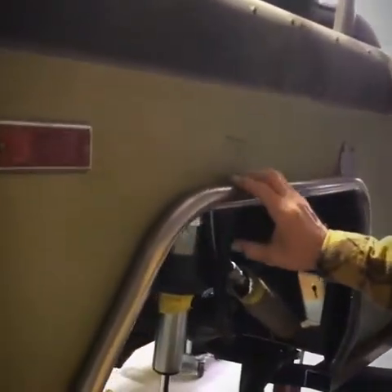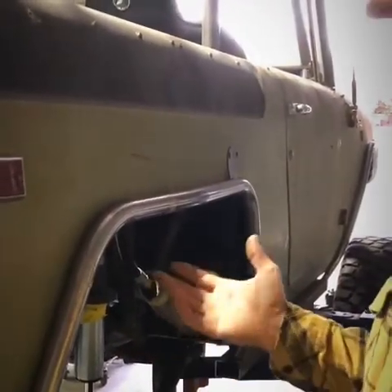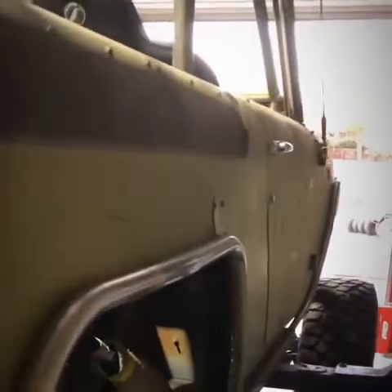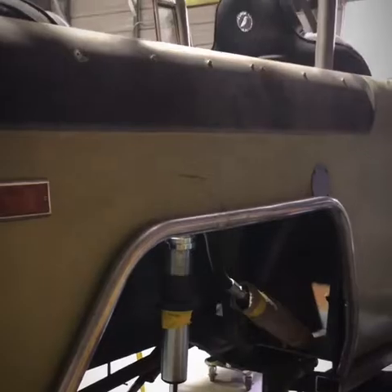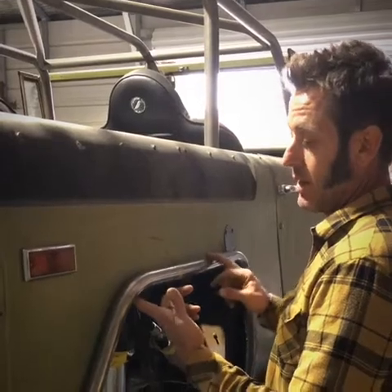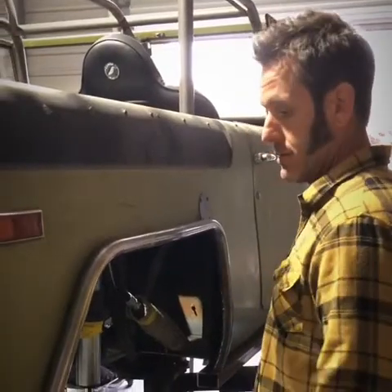Travis at Custom Works in Paso Robles helped me with a tube bender that he was unfamiliar with, and I'm not a tubing-bend guy at all. Together it took us a couple of hours per wheel well. We cut the wheel well after setting the tubing up and designing how it would sit, because it's probably harder to bend tubing in exactly the right place versus cutting sheet metal — you can put sheet metal anywhere you want.